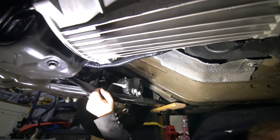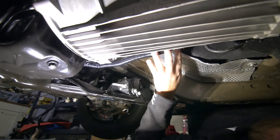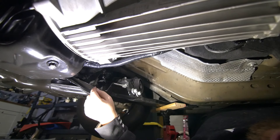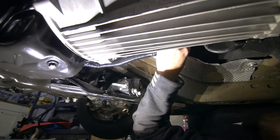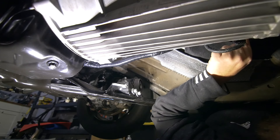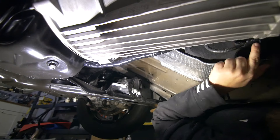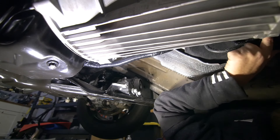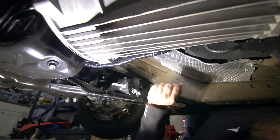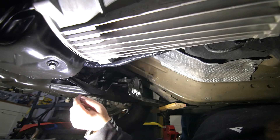I went ahead and put electrical tape and put all the wires back in the loom, so this is all snug. I put the mount back on so it goes to the transmission — it looks really good. This area got kind of tough so it may look a little sloppy but everything's covered. This is my driver's side O2 sensor plug, which I'm not running one right now — I only need to run one, the passenger side which is bank one. So I have this one zip tied up out of the way using a little mount on the transmission.